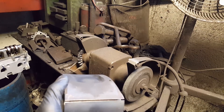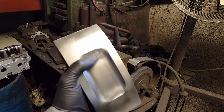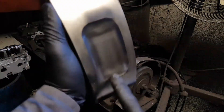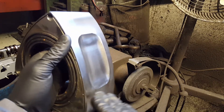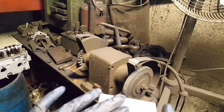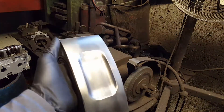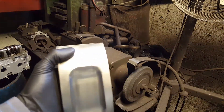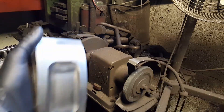Be gentle — don't be scared, don't worry about it. It's like any aluminum or metal head on a piston car. Another way to gain horsepower or gain more airflow is by porting and polishing. By polishing, you're gonna smooth all the surfaces out — it's gonna almost look like a mirror finish — and then the air is gonna hit in there and keep going without diversion. With the wire wheel brush I'm cleaning it, and at the same time polishing it a little bit. You can see the actual little lines from factory where they CNC made this one, and see all the carbon buildup on the other one.